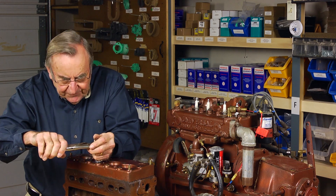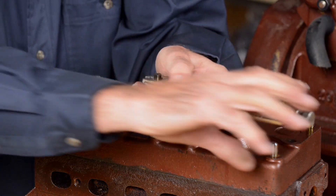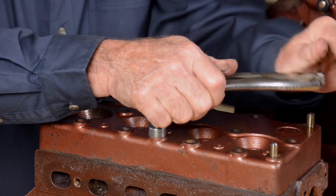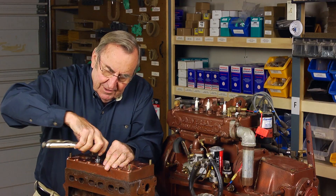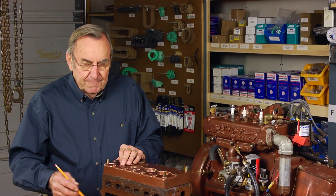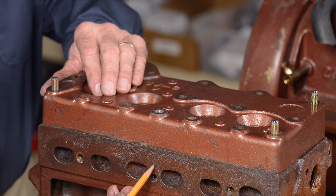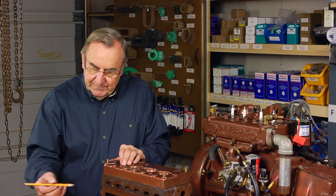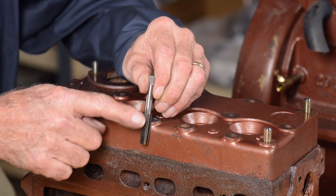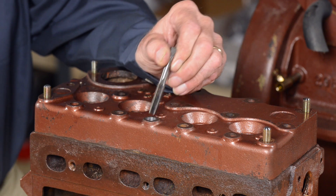With the stop ring perfectly set, you can actually feel the end of the drill coming through the bottom of the head just as the stop ring is reached, which is a really nice feeling. So with that, the hole is prepared now to receive the tap. To review where we are at this point: we have a 7/16th inch hole through the head and we have a 3/8 inch pilot hole into the block ready to receive our 7/16th inch tap.